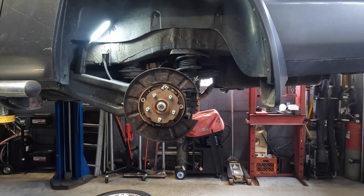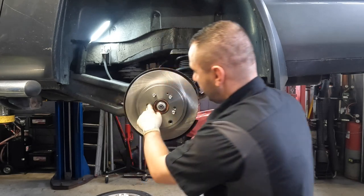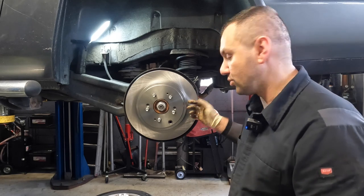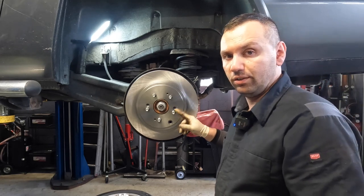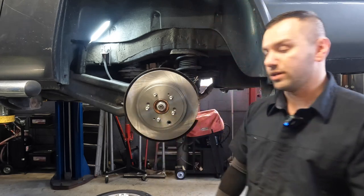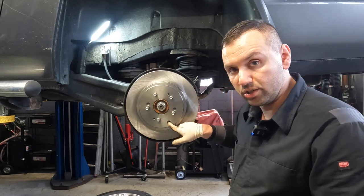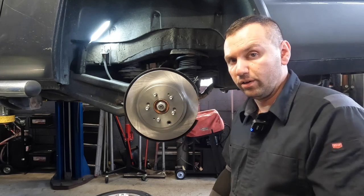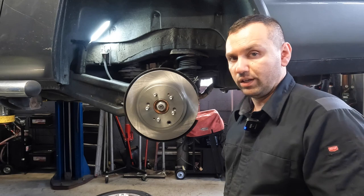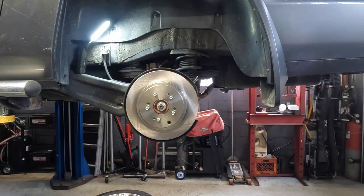What I'm going to do next is go ahead and take my rotor. You're just supposed to slide this in here. If you had the screws on your rotor to remove it, you may want to line it up, but this one didn't have them. They're not necessary - they're just good when the car is being built so rotors don't fall off. You are supposed to have a little rubber grommet here to block the parking brake adjuster hole, but this car has been to a different shop prior to mine and it looks like they lost those. I did mention this to the customer during inspection - he doesn't really care since his car sits in the garage. So I just let it be.